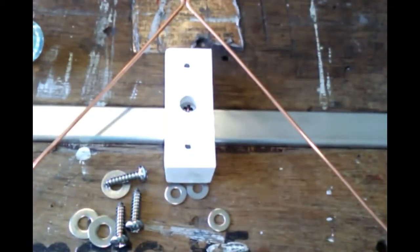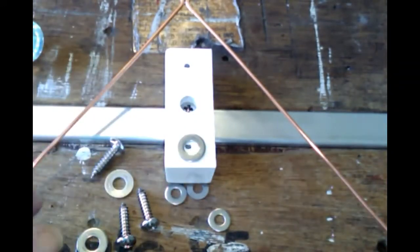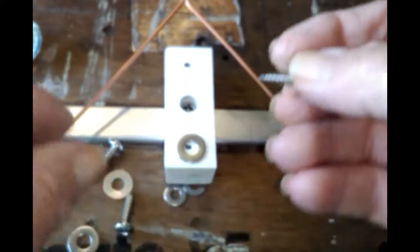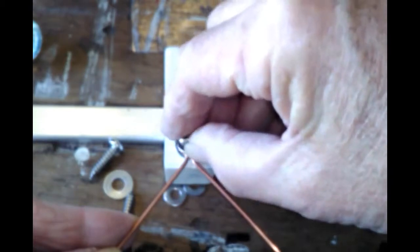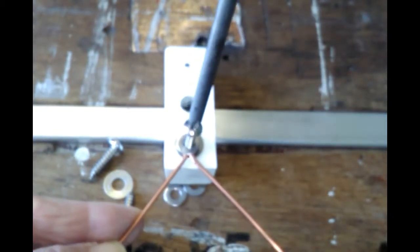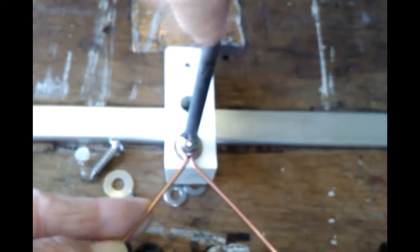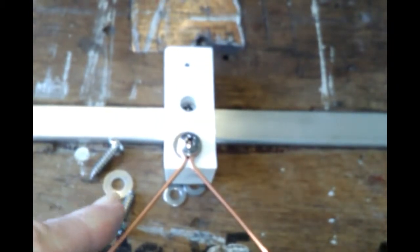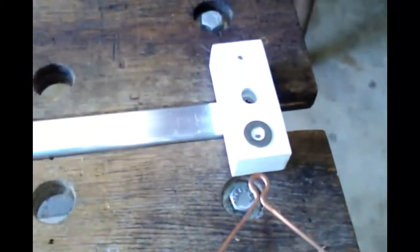For the element, I take a large washer and lay it down where it goes. These are number 10 screws — 10 by three-quarter inch. Starting in the center, put a small washer on the number 10 screw, get it started straight, and just screw it down. Don't go all the way — just get it tight so it stays in place but can still move around a little bit.